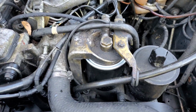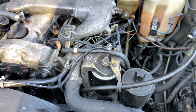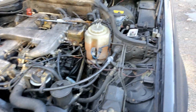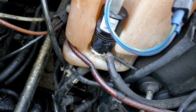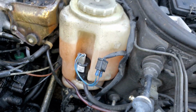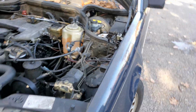We changed the fuel filter and the primary fuel filter. This is the secondary fuel filter. We didn't put any fuel in it, so then we went to start it, and then it was nice and dry. So after a while, we got it bled, and then Ryan over here got soaked. We fixed this leaky thing, and Ryan put some putty type stuff in there that's water safe, so it holds great now. Now we just have to figure out what exactly was all on the fuses we took out.